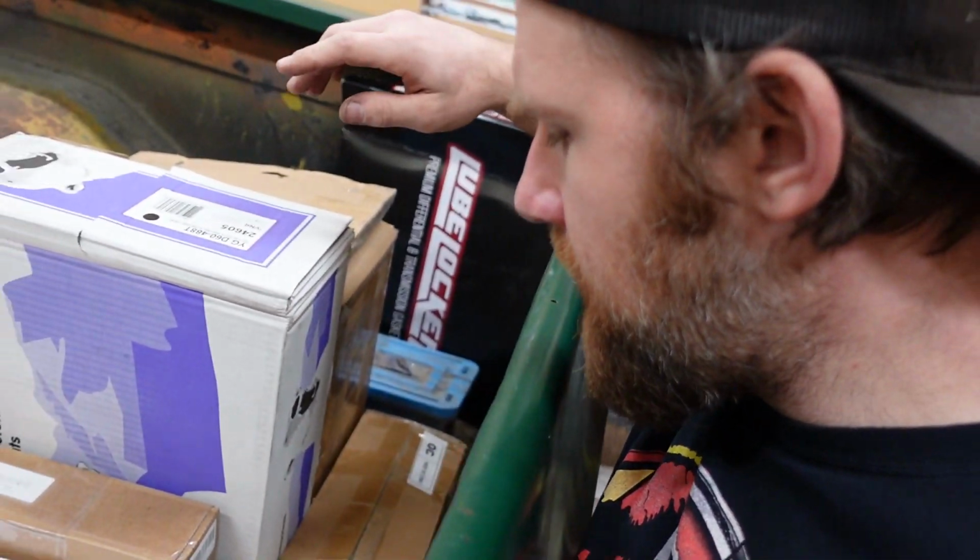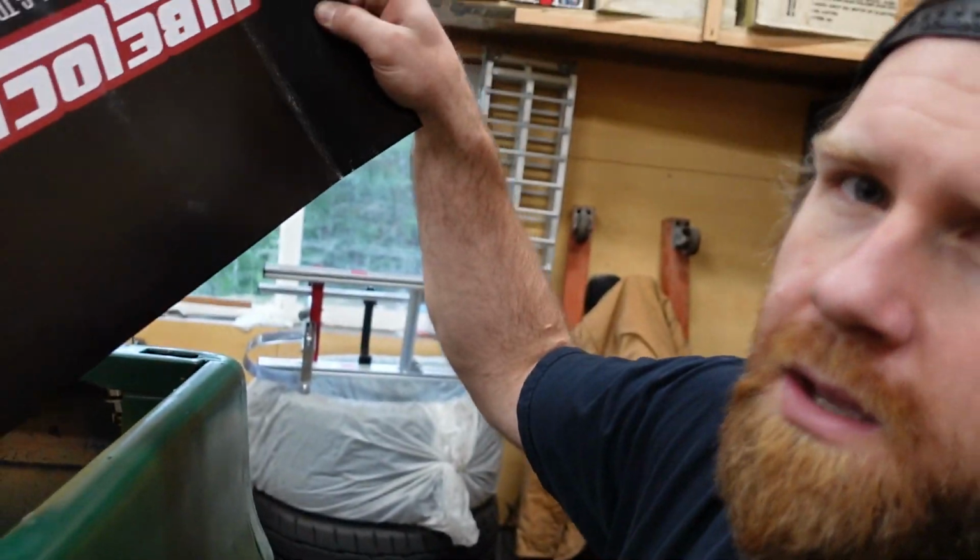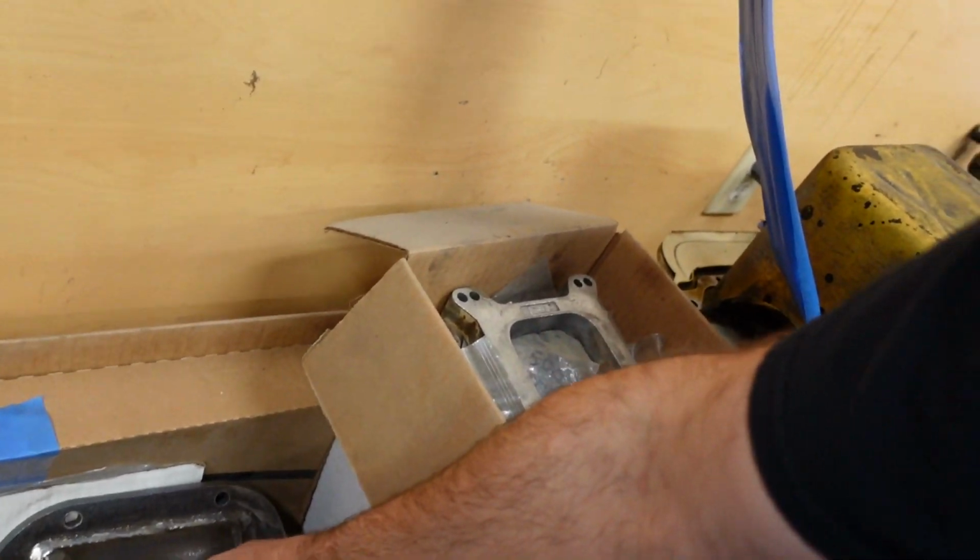And then I have the Spicer gears. I think they're in this box. The rear is getting Spicer OE 488s to go on the spool. So once the spool shows up, I can start on that. Oh, and lube lockers too. Bingo, lube locker. I've got a stack of parts over here too. So got diff covers. These are DIY diff covers. Beefy, heavy duty, those are going on when I do the re-gear.